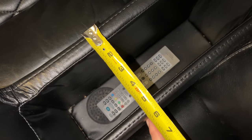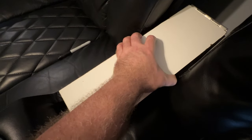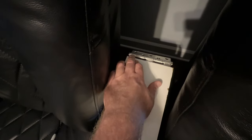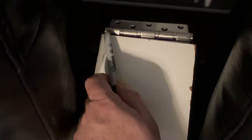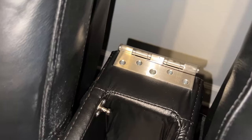I'm right about five and a half inches at the narrowest point — you can see it's bowed in at the center a little bit, so that's where I'm going to measure for the side. Now that we've got our blank cut to exact size, we want to make sure it's laying here centered. Run your fingers and make sure it's even on the base of the seat. I've got it as far forward as it'll go without going up that little curve, and the back is just touching the corner of the bracket. I marked the center point of the board and then mark a line on the bracket along the edge of the board so we can figure out where to put our holes.